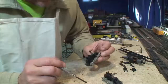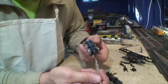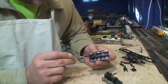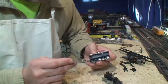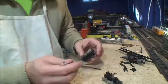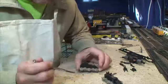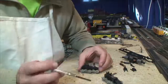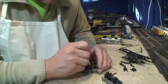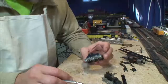Here is the trick. To get these trucks apart, we go in from the side. Do not stick your screwdriver in the end of this and pry it off, or you will break it, especially on these old ones, which probably had a bunch of oil — they're probably filled with oil. One, two, and we're off, and we didn't break it. See that? You don't need to use a ton of force on it. Don't pull out the hammer.